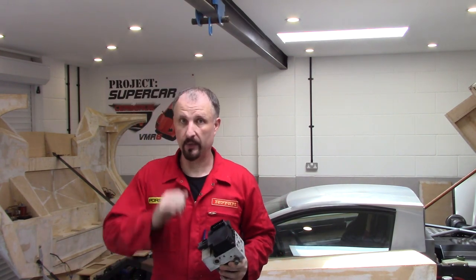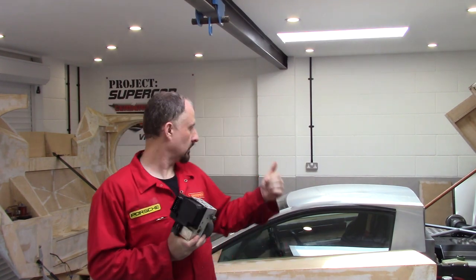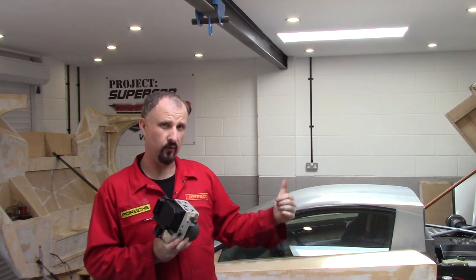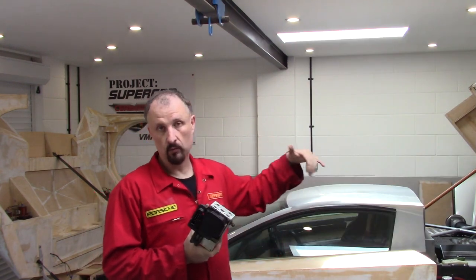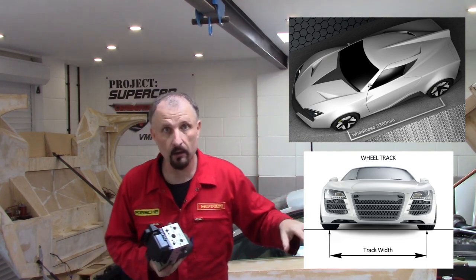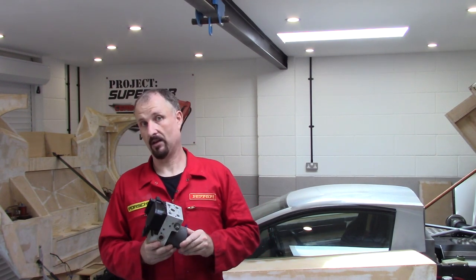Going over what we have learned: the BMW and Audi hubs have different sized teeth wheels, they probably have different sensors, and the wheelbase and track are different as well. So, am I going to be fitting ABS to my DIY supercar? No, I don't think so.